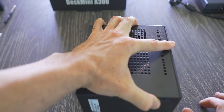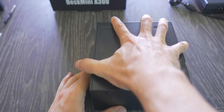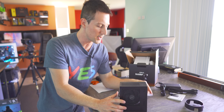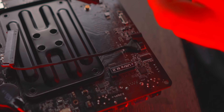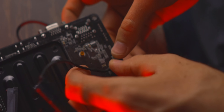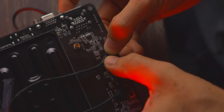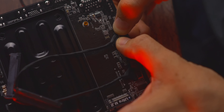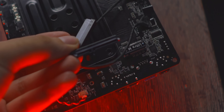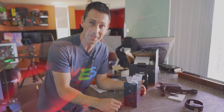I'm hoping it's not an issue since the edges of the fan are a little bit taller than the actual blade itself. There are also two SATA 3 ports included - you can RAID these over RAID 0 and RAID 1. There are also two NVMe slots, one at the front and one at the back, though you will have to pull the motherboard off the tray to access the rear one. Let's jump into the BIOS and see how well we can tune this thing, then try and run some games.